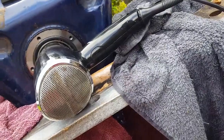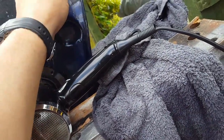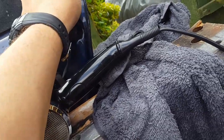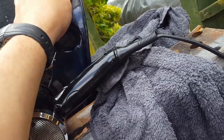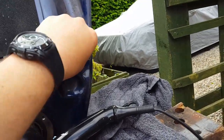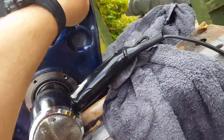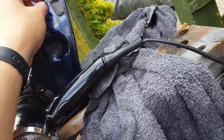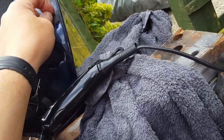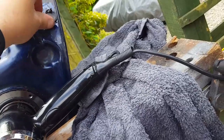Then it's whether I squirt a load of WD-40 in there and then put the petrol in, or just put petrol in — knowing that all the rust is out and there's a layer of iron phosphate in there. Whatever happens, it's obviously going to be way less rust and less problem than it was before. Just reading other people's posts who do the tanks — they say once you get it dry, coat it with oil, a light oil, or WD-40. Give it a splish round. I think I'm going to do it anyway.